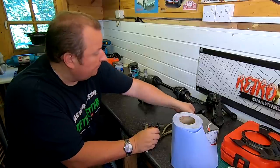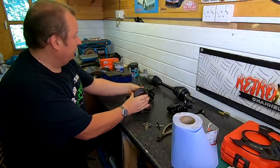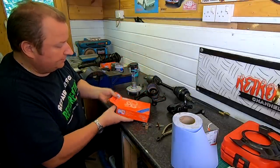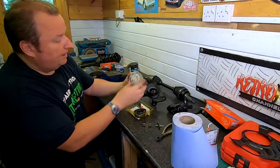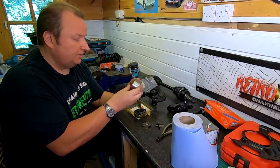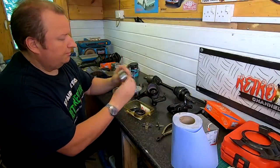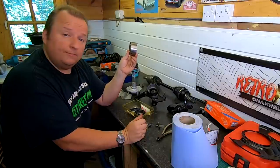What we've got to deal with now before we go outside is the installation of the new bearing, and the hub center has to go through the middle of the bearing. This looks like a new old stock kit. I've actually measured these and they're the correct size, so we're happy with that. We've got the actual bearing there — technically speaking I should have put it in the freezer overnight, but I didn't realize I'd be doing this video today. We've also got a dust seal for either side, so I've just got to make sure I get these in the right order. Apparently these only go in one way, so I'll have to check on that. Let's get the new pressing tool out.